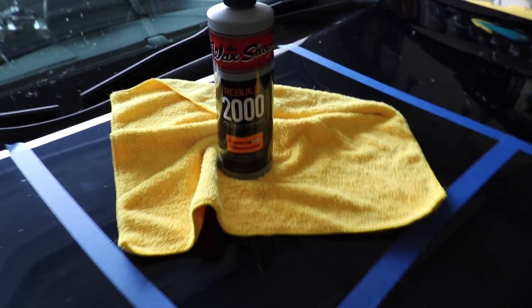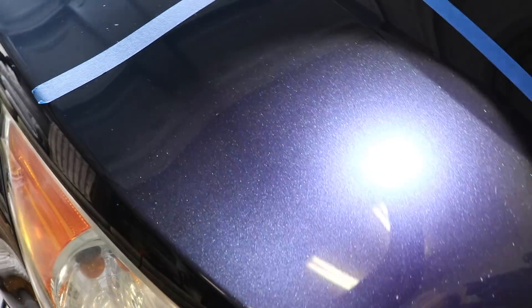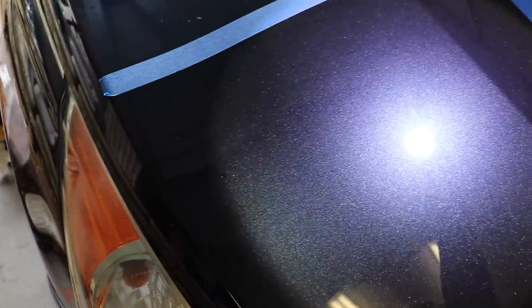After the second step — the 2000 Rebuild medium cut — here's what we're looking at. You guys can see it's really starting to turn out. This is not a high gloss or a finishing polish, but you can see the swirl marks really starting to just fade away. This is where we used the 1000 then the 2000, and here's where we just used the 1000 — you can see that dramatic difference of those buffer tracks starting to disappear. The 1000 really hit the swirl marks, and then the 2000 really hit the buffer tracks.